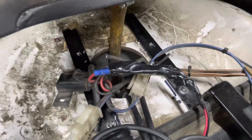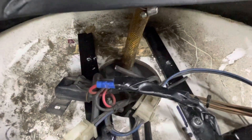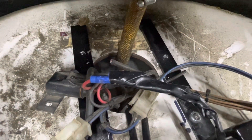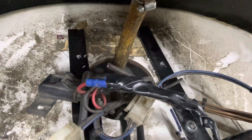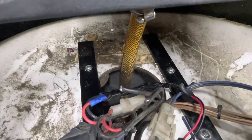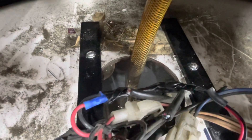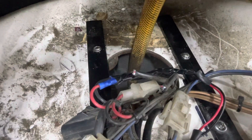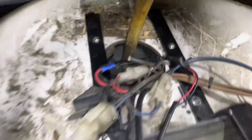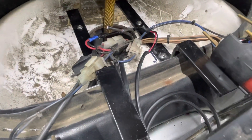Just wanted to let you know — you do have to go in underneath the dash and drill those back holes from the bottom; you can't get a drill back in far enough from the top. About two bolts is all you're going to be able to fit back there. I wasn't able to use the aluminum bracket underneath because the steering oil line interferes, so I got some gigantic washers — as big as I could find — to give as much support on the bottom as possible, and bolted them from the bottom with lock washers. They are really, really solid.